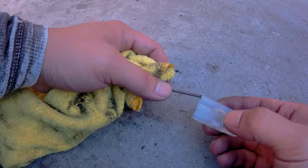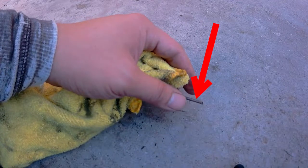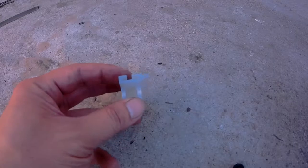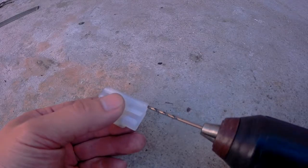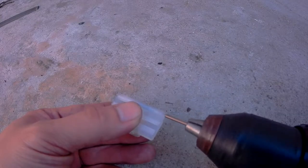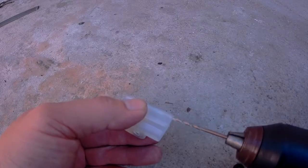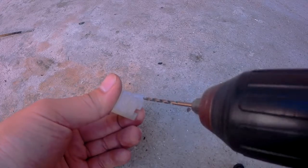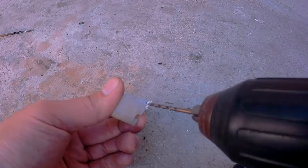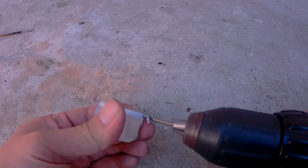Attempting to insert the cable into the part, you'll find it won't fit. In this case, Billy recommends you grind more material off of this cable in order for it to fit into the hole, and you'll want to grind it down so you can pack it with epoxy glue. Instead of going with Billy's recommendation, I expanded this hole using a 3/32 bit. Since I'm removing more material, there is a higher chance of this piece breaking. If you go with this method and you get your drill bit spinning, don't put it into reverse — just keep it spinning one way. I then followed up with a 7/64 bit. You'll want to start it off slow so nothing breaks, and once it gets going, just keep it going. Remember to just keep it going one way.